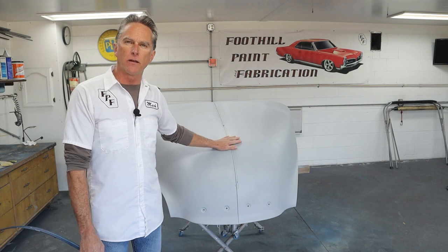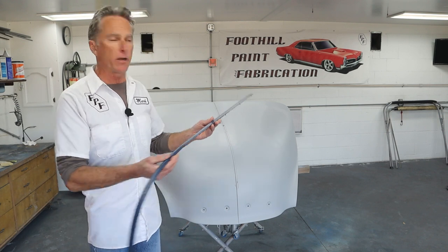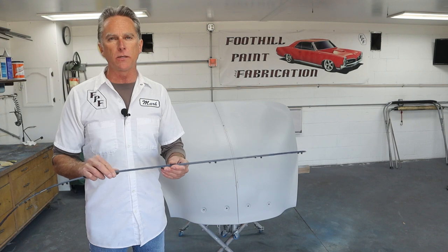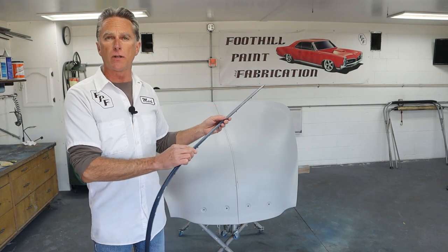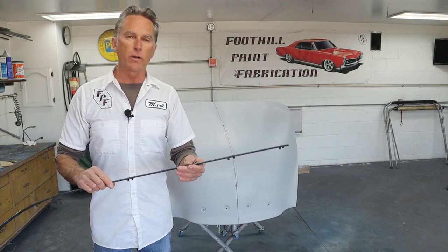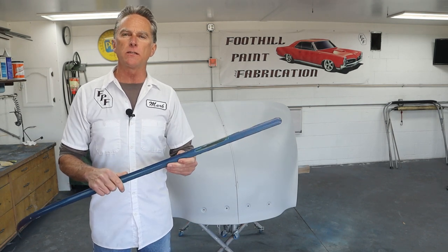Last time you guys saw the hood, we were getting some primer on it. We got it all sanded up and repaired with a nice coat of polyester primer on it. But before we can sand, guide coat, and block it out, we need to get the center molding strip ready to go. We want this strip to basically be ready to just fall back on the hood — we don't want to be screwing around after it's done and polished. You don't want to start bending things and trying to make them fit at that stage. All these little tabs need to be straightened out and we need to do a lot of test fitting to make sure it's going to fit on really nice and lay perfectly straight. We also need to get all this paint off — it's got gobs of paint on it. I think we'll do it mechanically with a wire wheel and maybe run a DA over it. Let's get over to the bench and take a look at these little tabs.